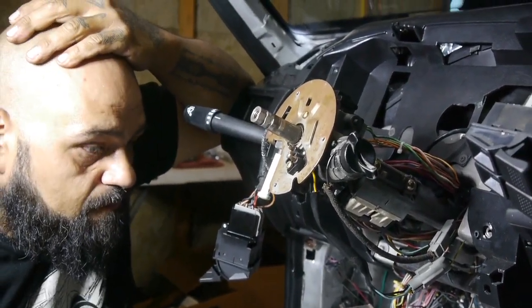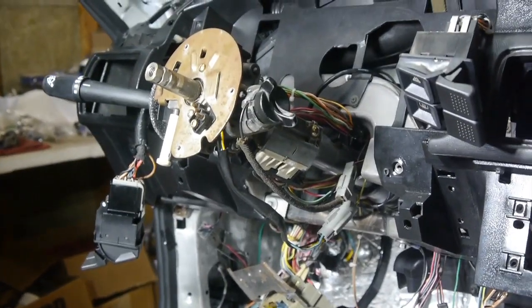Here I am again to disappoint you, friends. Unfortunately right now my relay's not working. I thought it was, and it's not. I actually tapped into the main power of the relay instead of going into the lead of the feed that gives me the click. Right now checking it — it's not working. So we're going to go ahead and get another relay for it. I was trying to keep the old stuff, but I'm done trying to do that. I'm just going to go ahead and get a little relay kit, set it up the way it should be done. I'm getting power through this, so I'm going to keep the connections on my steering wheel and just transfer the relay in.